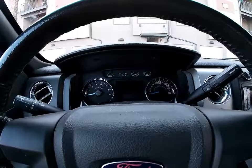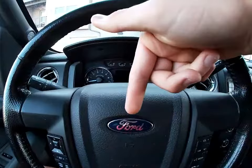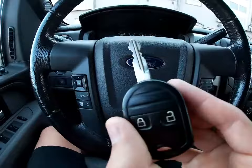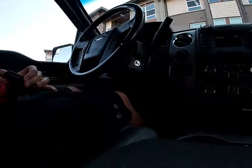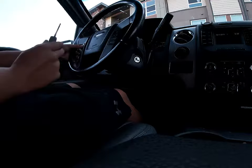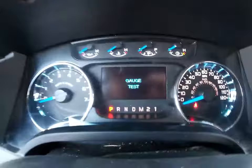OK guys, let's start that process off. The truck does have 100,000 miles on it — Built Ford Tough right there. So make sure you have your Ford key in hand. Put your finger over the OK, foot on brake, and start. Over the OK — put your thumb over. One, two, three. Stick the key in and turn. Now keep holding the OK until gauge mode comes on. Gauge test — you'll see it'll do a quick little sweep of the gauges.